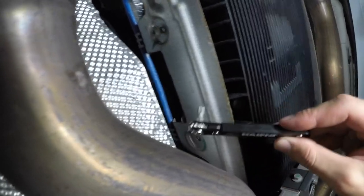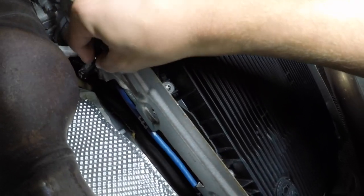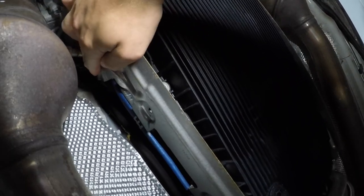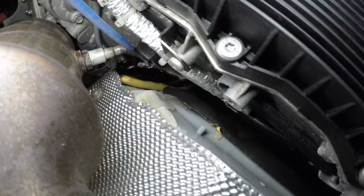Definitely wait until your exhaust system is cool. Then grab your little driver with a Torx 30, loosen the screws, and then take your hand and loosen the rest with your finger. Right up by the catalytic converter it's really tight — the only thing you'll be able to get in there is that tiny little driver, which is why it's worth the $5–$10. I did not wait until the exhaust was completely cooled off, so I almost burnt my hand five times trying to get my finger up there. So now you guys know — definitely wait until it's cool.